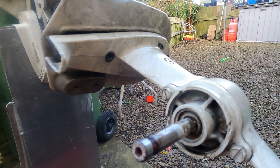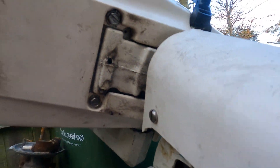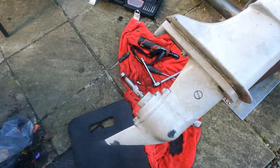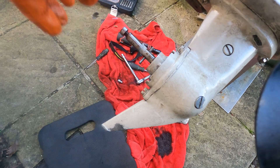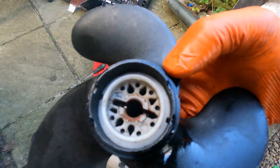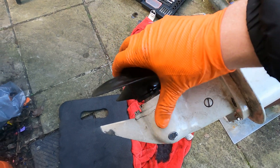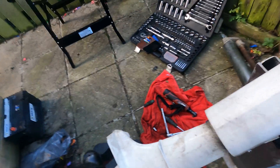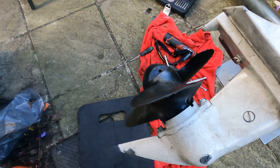We'll put the prop back on and we've got to put some gear oil in as well, and then it's good for a test run — we can test whether water comes out of that little pee hole. For the prop reinstallation: there's a shear pin that goes through the hole, and on the inside there's a plastic cutout that slips straight over. With some wiggling it'll engage, then put the pin through. I'll put the old one back through for now but we'll get a new one.